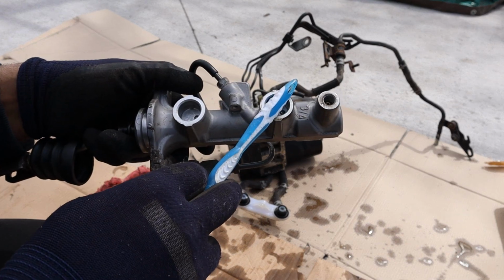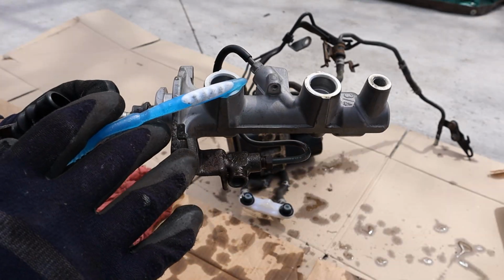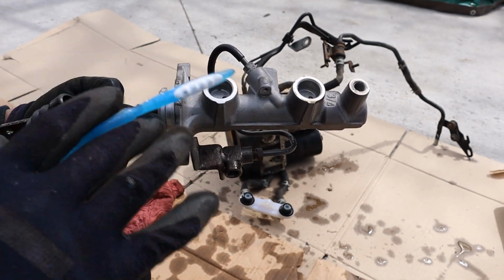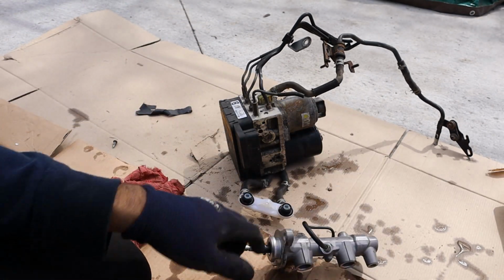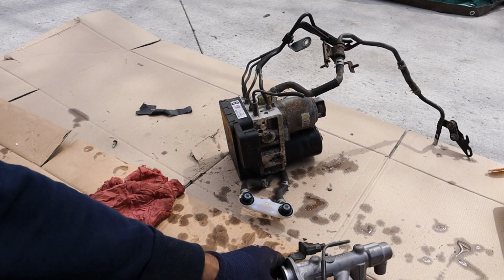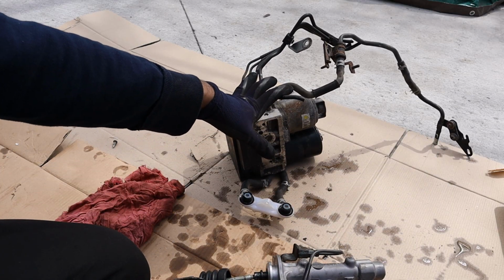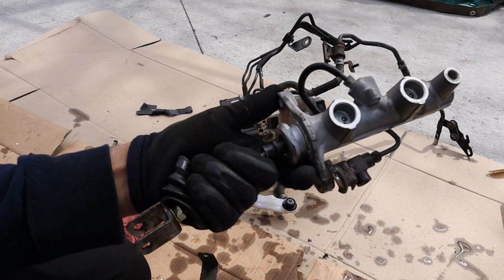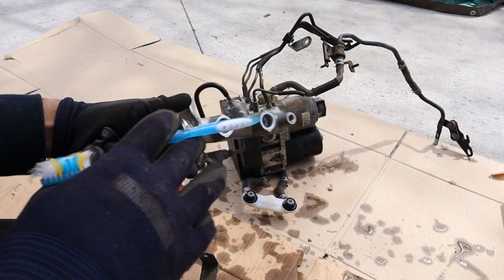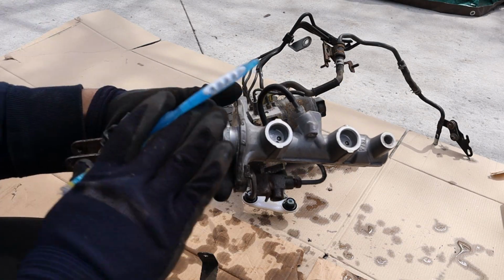Now, the next component in the system is one of these lines here are going to tee off and go to the stroke simulator. Now, in a more conventional car, the master cylinder's pressure is what's going to go through the ABS module and directly to the wheels in order to stop the car. However, in a hybrid system, they completely block off all of the hydraulics that go from this master cylinder at the ABS module, and that's responsible for creating the hydraulic pressure for each wheel. Well, in that case then, when you push your foot down on this master cylinder, if it's completely blocked off at the ABS module, then the brake pedal would be super hard and you wouldn't get any feel for where your foot is down on the brake.